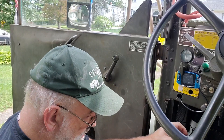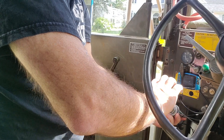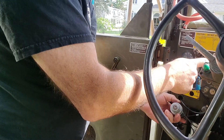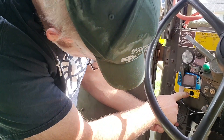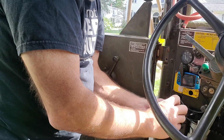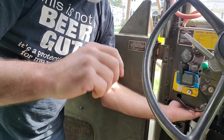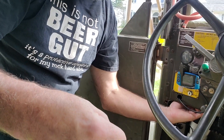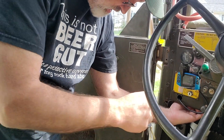The problem I've been having with this ignition switch is it tends to turn the whole switch body. The on-off switch has that little nub that fits in the hole, and the starter switch also has a little hole, but the replacement ignition doesn't have a nub. This ring nut does not give enough tension to hold the assembly in place against the force needed to engage the key in the ignition.